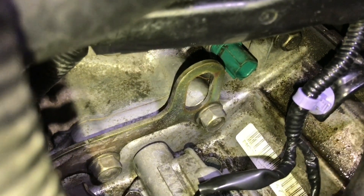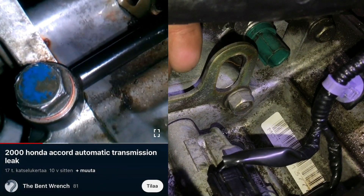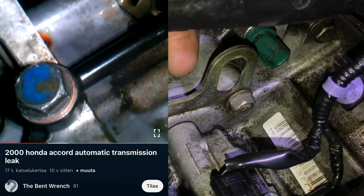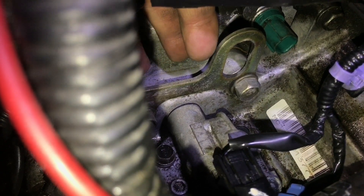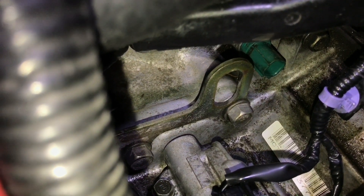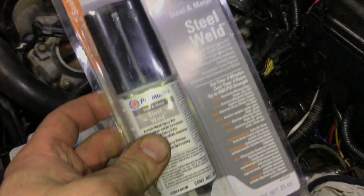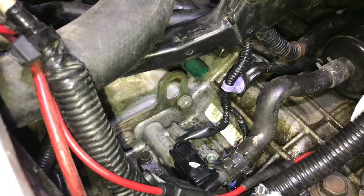By chance I found a video where someone had placed a camera nearby and gone for a drive. From that you could see that from the gasket between the engine blocks, a fine mist started to appear gradually and then it collected there. In the video it appeared quite quickly, but this has been a really minimal leak — that's where it's coming from. The gasket there is so thin that it just seeps through. We'll seal that too now that we know where it comes from. We won't remove the gearbox for it, but others had done it by applying chemical metal epoxy over the top.